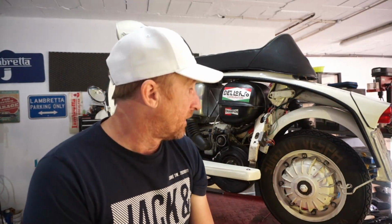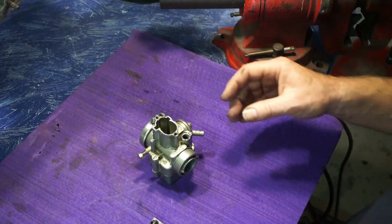Okay, we've been on a little quick test drive. We didn't have to go far to see how bad the carburation was. So the main jet's too big for starters. It just doesn't rev. And it's got quite a bit of splutter in the mid-range as well. So we'll try to clear that as well at the same time, because we're only going to come down a little bit on the main jet. It's not massively big. So we're going to whip the carb off and have a look.